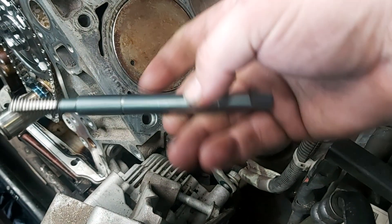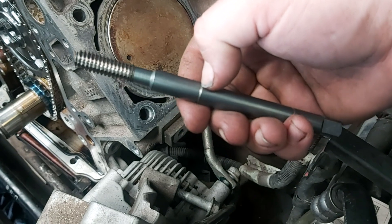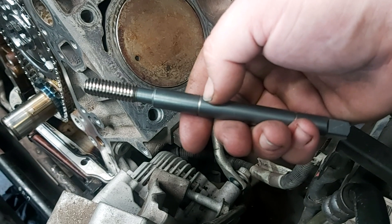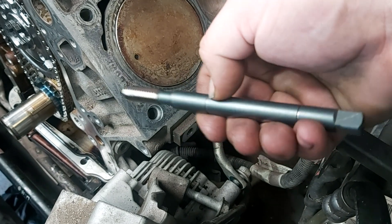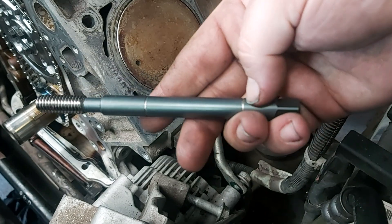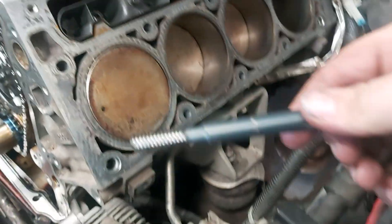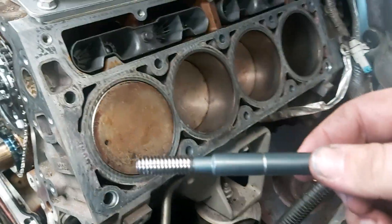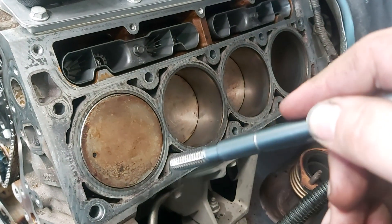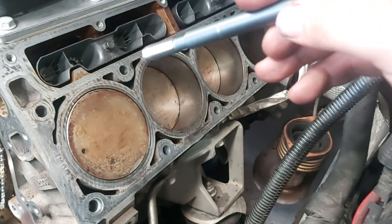Really nice tools. They're marked for LS2 later bolts — you'll run this in until it sits flush with the deck. On the earlier long bolt LS1 and LS6, it's this one, except for your two outside bolts. It's super tedious doing one after the other the whole way along, but it is a hundred percent better than stripping a thread.